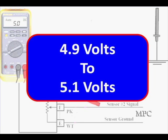4.9 to 5.1 volts is a number we have used for years and years. It works almost flawlessly on everything. The only exception I can think of is a Chrysler Jeep truck electronic controller — JTEC — which goes up to 5.25. Other than that one computer family, everything else I've checked falls within these numbers, because this is the voltage needed to run the computer.